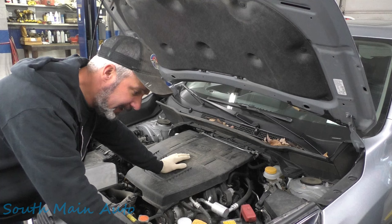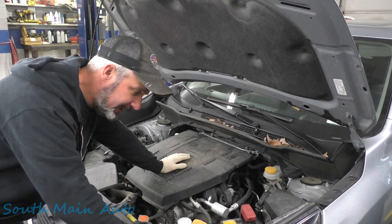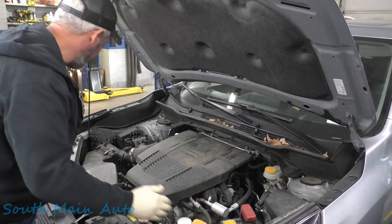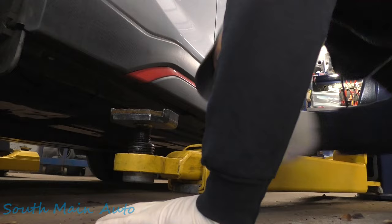I took it for a drive. It does have a bit of a spongy pedal, nothing crazy. If you climb on the brakes heavy they do have a bit of a shimmy. Apparently this car's never had front brakes and it's had one set of rears, so we're going to pick it up, have a look, see what it needs from brakes and see if we can get some stuff today.